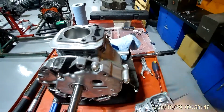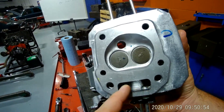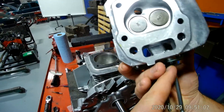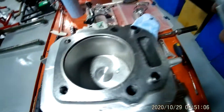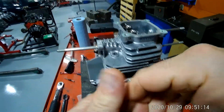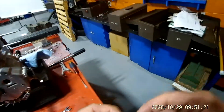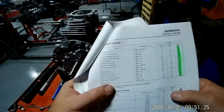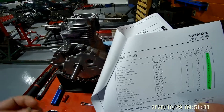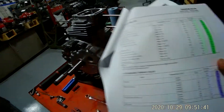When you look at your cylinder head, you're going to see two ports right here. This port is on the carburetor side and that's going to go right here. These are M8, 1.25 pitch bolts. I didn't see a specific torque spec listed for the cylinder head cover, but assuming it means the valve cover, we're going to go with M8 at 15 foot-pounds of torque.